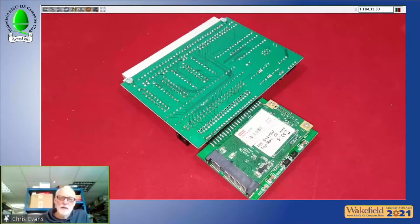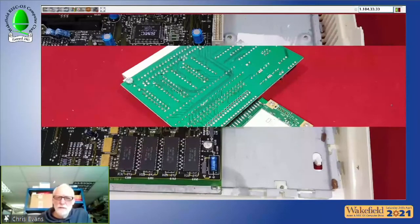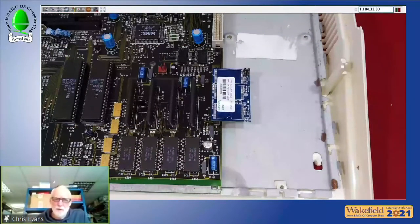For machines like the A5000 there's no point going beyond 2GB, but they can supply up to 128GB. For A3020 users, they've sourced 1GB disc-on-modules with a 44-pin connector that plug straight onto the motherboard as a hard drive, with reasonable stock to last several months.